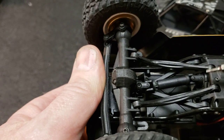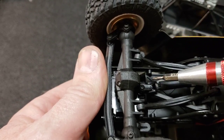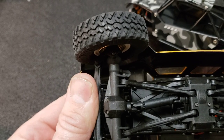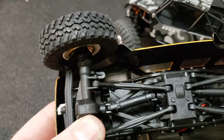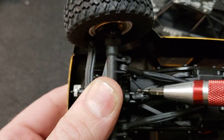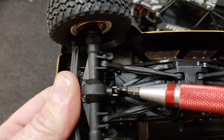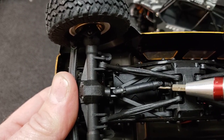What you're looking at is the ends of the driveshaft — this end, the flange yoke, and this flange yoke. That's the end part. And what you want to see, if it's properly aligned, is this one here that makes a C, and this one here makes an opposite C. This little pin is the hinge for this one, and this pin is the hinge for this one. And they're parallel to each other.